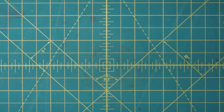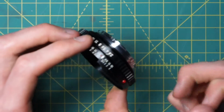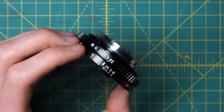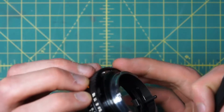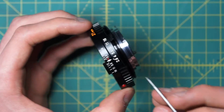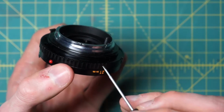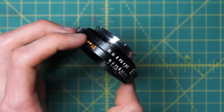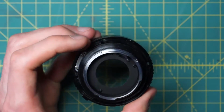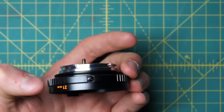And let's take a look now at that mounting plate again and actually remove one last piece in here. We're going to remove the aperture control ring. One reason you might want to do that is this allows you to make some adjustments to how the aperture is controlled. And it also allows you to then clean the aperture control ring on its own, because it has these grooves here. Those tend to build up a lot of grime and other stuff, so that's one reason why you might want to remove the aperture control ring. For most disassemblies though, this is completely optional.